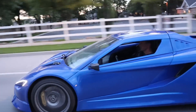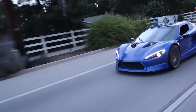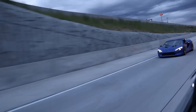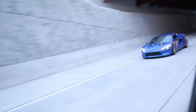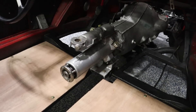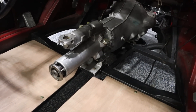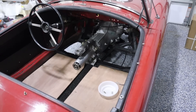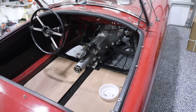You've seen me work on the blue car — Watson — the original build. That had a Tesla motor that could go up to 18,000 RPM, which is about 150 miles per hour, so no need for a gearbox. This one, however, goes up to maybe 6,000, even up to 8,000 RPM, so you need a transmission if you want to get going a little bit faster.